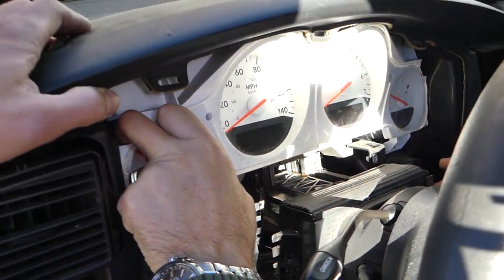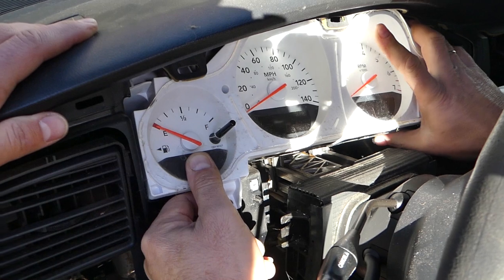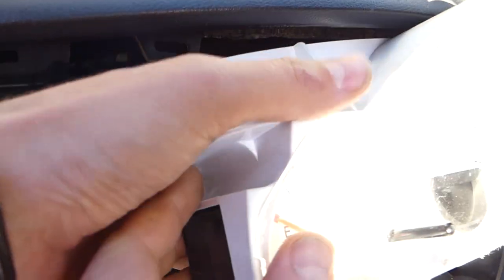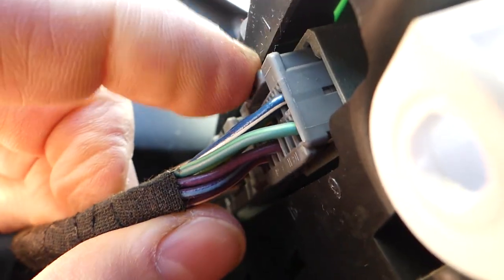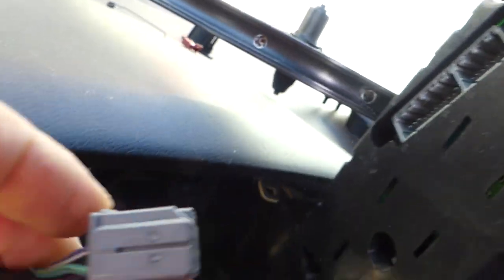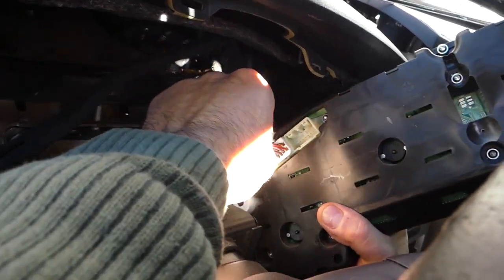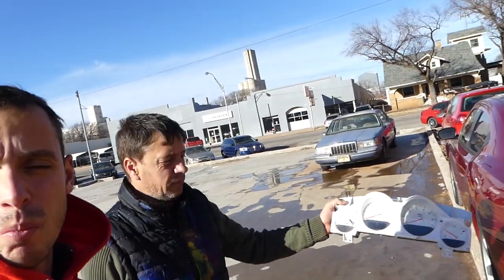If you flip it like that, you can see one side coming out a little bit, and now this side is still holding a little bit. It came out — be careful not to crack the dash. Now we have the wiring harness here. Press down and pull — there are two of them. One of them is stuck. Press that piece and it came out. There's one more on the bottom — three connectors altogether, though some have four depending on the model.